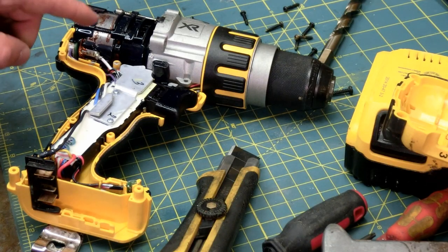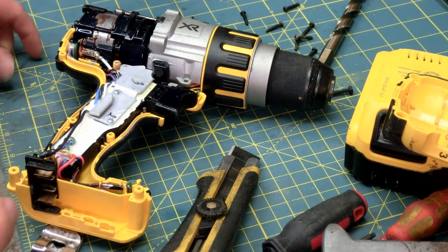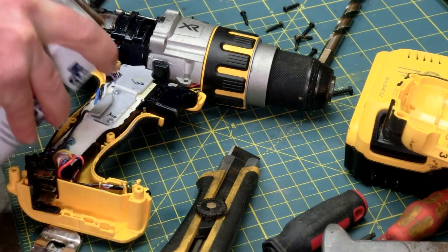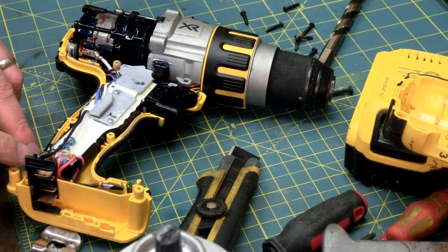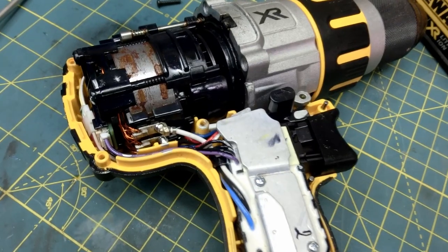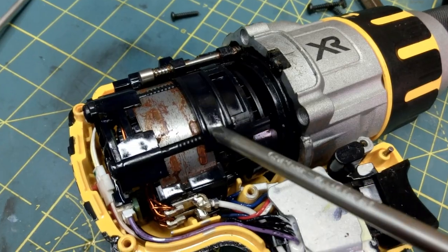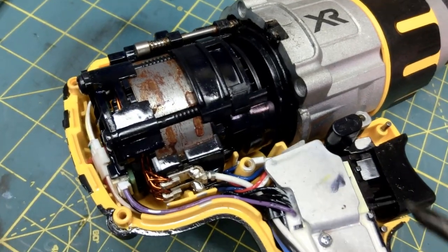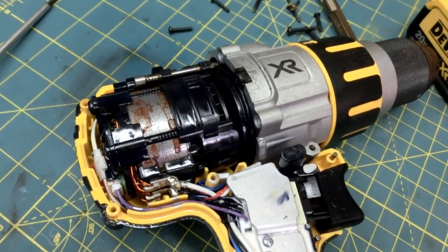Now you can see this one's actually been under fresh water before because it's got some rust, but surface rust every once in a while is no big deal. You want to get it on the soldered leads but avoid these spade connectors that go into the battery. We've let that conformal coating flash off and it's hardened nicely — you can see that nice thick layer. A couple of coats is all it took, so now we can go ahead and put this back together and move on to the next stage.